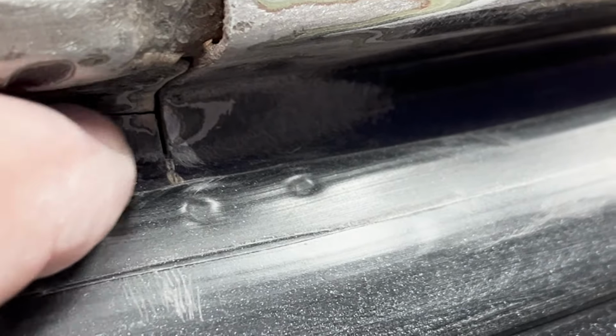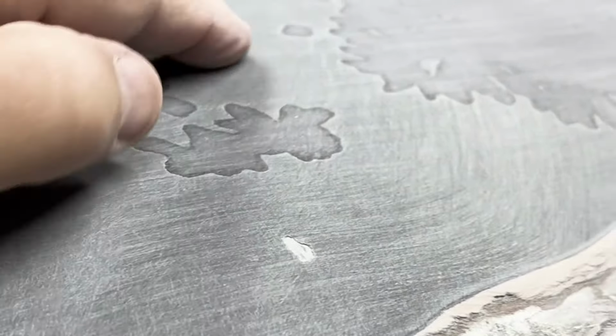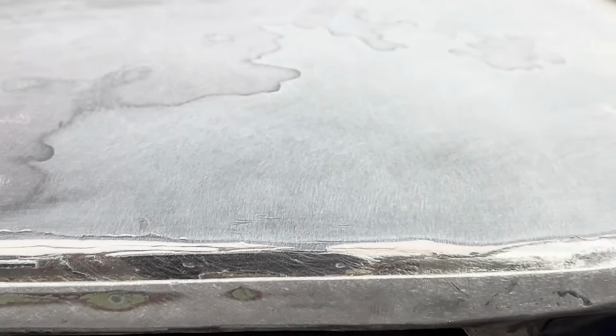You can't even tell it was two pieces. It was like that. Yep, some metal fatigue right there. Gotta weld all that closed. Do the same thing on the other side, and then get all this clear coat off. This clear coat's gotta go, and then it's gonna get primered. There's some clear coat still up here. That's gotta all come off. It's really hard too, but I'll get it off. All right, stay tuned, guys. Thanks for watching.